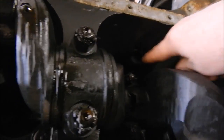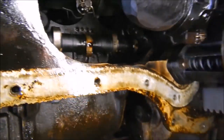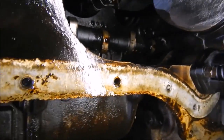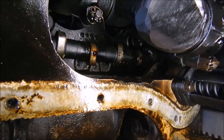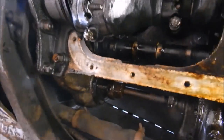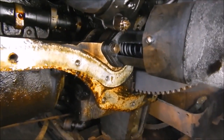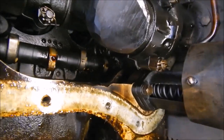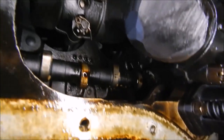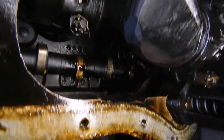Here's the hole that comes down from the oil filler. There's a gear that drives the camshaft — that's in the front, driven by the timing gear. And what's this? That drives the oil pump. The camshaft drives the oil pump right up there — you can see the gear in there, and here's where it comes in.